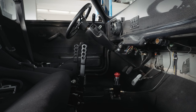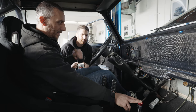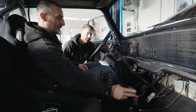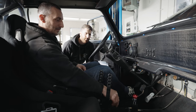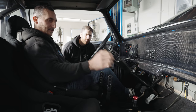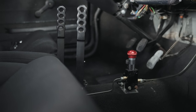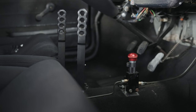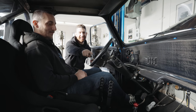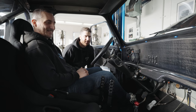There's a fair bit going on with the controls. There's a hydraulic parking brake because the four-piston calipers have no provision for a cable-operated parking brake — it works like a line lock: foot on the brake, click the knob, and it locks. There's a proportioning valve to adjust brake bias, a drift brake, and a sequential shifter — one forward, five back, so full six speeds. Reverse is handled by the e-brake handle if needed.